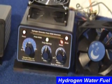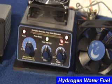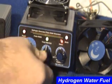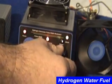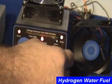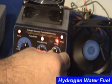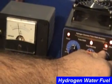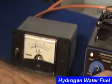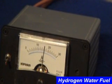When the temperature light is activated, you will have the option of having the PWM automatically cut back the hydrogen production to prevent overheating. I can briefly demonstrate this by rolling the temperature switch back. If you watch the amp meter, you can vary the cutback. Now we'll roll it forward, back to the normal operating mode.